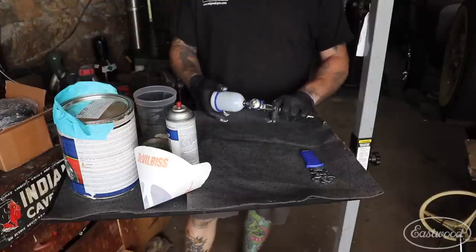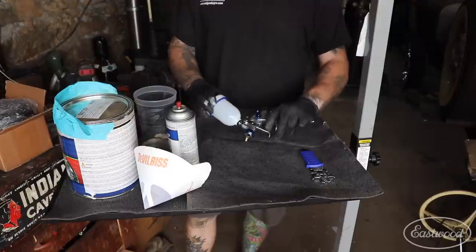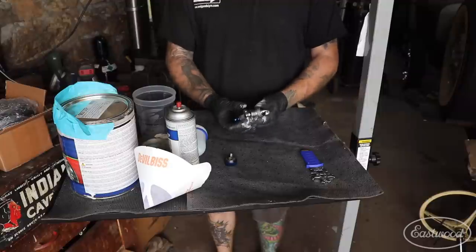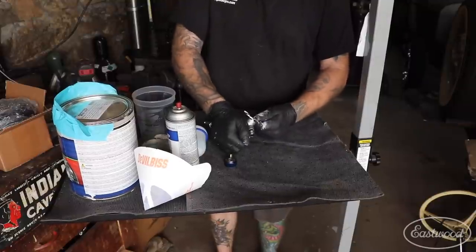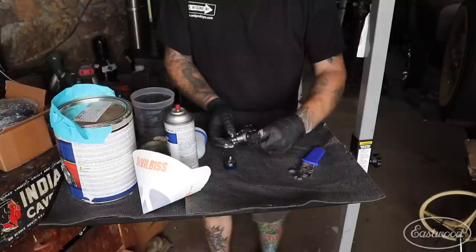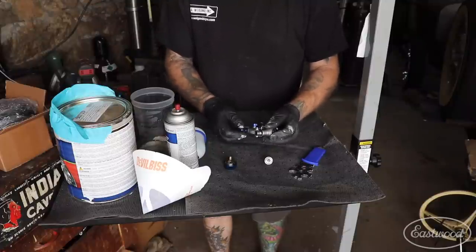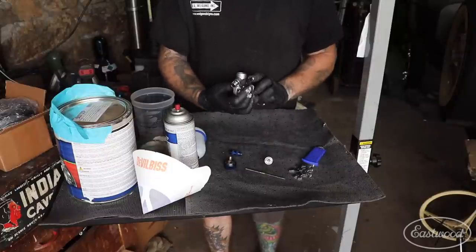While we have our primer drying, we can go ahead and get our paint gun out. It's the Concourse Pro Detail Gun, or jam gun, and this gun is brand new right out of the box. The first thing we want to do is take this gun apart and clean out all the orifices and areas, because there may be some minute traces of machining oil from production that we want to make sure is all cleaned out. Starting with a fresh, clean paint gun means no problems or contaminants. While I'm spraying a single stage today, we still want to make sure everything is nice and clean.